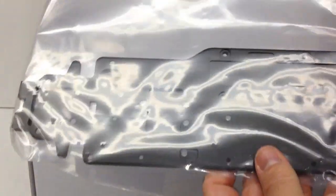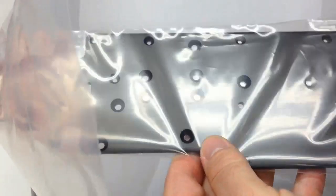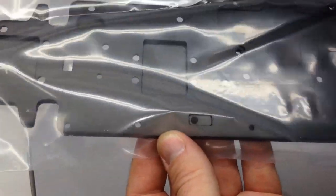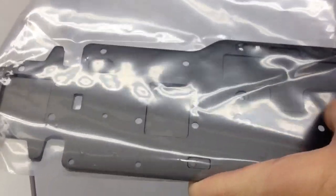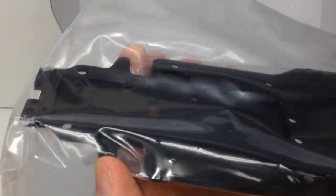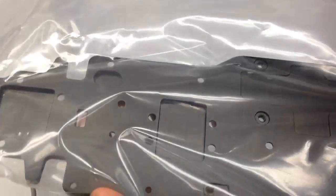One of the last big parts in here is the chassis. This is the stock black anodized chassis. I believe they do offer a lightened one that comes in a gold color. The chassis is just super thin — it's almost like 1/8 scale buggy-ish, definitely thinner than the SCTE by far. But it comes stock with all of these CNC cut-outs where they've tried to save a little bit of weight on either side of the diffs. You've also got the little adjusters there for your droop settings. All in all, very nice chassis — looks like an upgraded chassis right out of the box.